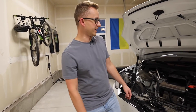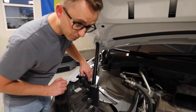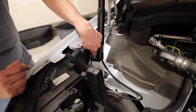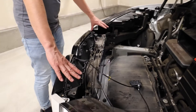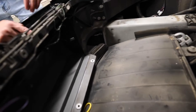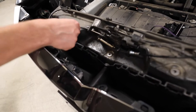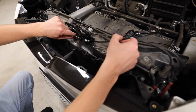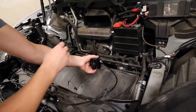All right guys, so we had to turn the car around — it got pretty dark. One thing I did as a mistake: I put these shocks without putting this bracket in first. There's a bracket in here that you have to replace, and what it does is it puts that ball a little bit lower than the original spot. So those brackets you have to install first. I did remove more parts over here — this panel right here was a little challenging. There's two screws that hold the button and we removed the button. You have to really pry this, either take off the bumper or put a little allen wrench in there and unscrew it. Other than that, not too bad — we got the bracket in for the latch so it's all attached. Now we're kind of working on the electrical and we'll just keep going.